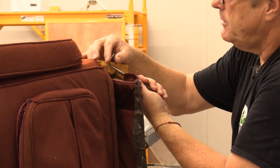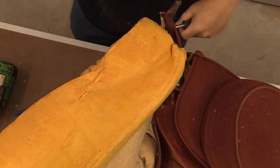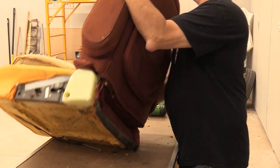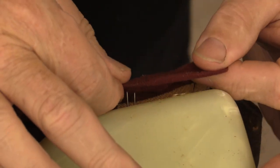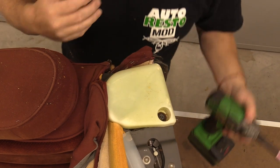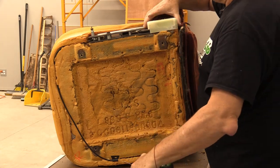There's a clip in there — this came out a lot easier than I thought. This clip basically holds the top part of the seat to the bottom. There's a pin on the base that goes into the hole on the top part, so it won't fall out yet, but it can get wobbly and loose. When you're pulling a seat apart, check everything. Ford actually used a very small thin staple to staple this piece of fabric to the back of this plastic plate. The plastic plate may have been put into play specifically so this could be stapled over. This is a half-inch bolt and this plate should come off now.